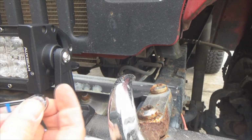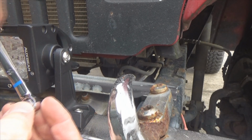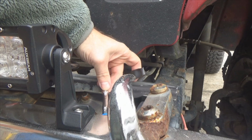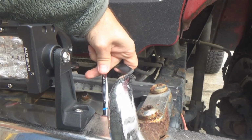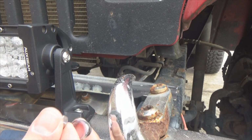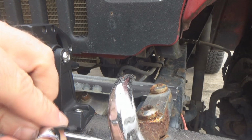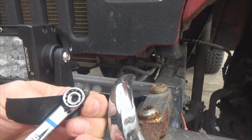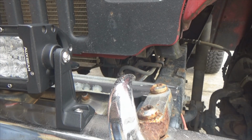Now before you put the tape on, you really need to figure out, since you got this angle on the head of the wrench right here, which way would be the easiest way to get into that. If you went like this, would it be the proper angle? Would it be like that? Well, at this angle, it's going to be like this with the head pointing up. So put that there, tape on the back side, like that. And if you want to, you can wrap it up a little bit to make sure it stays put. Then we can get to the bottom side of the bolt.